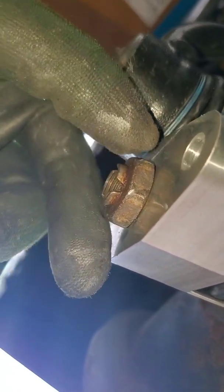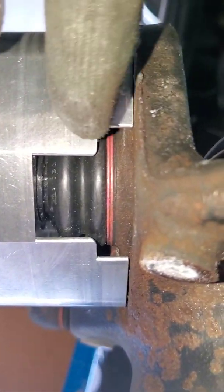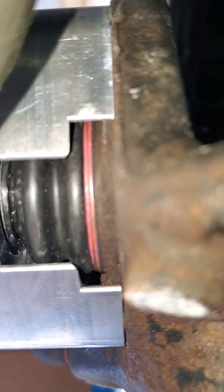I've hand tightened the ball joint nut. I'm gonna grab my ratchet — this is a 24mm nut — just tighten it, continue tightening it. Because this is a Massachusetts car with a whole bunch of rust in it, what should happen is the ball joint should continue sliding. It's about 45mm of travel, so it should just pull it right out as you're tightening this nut.